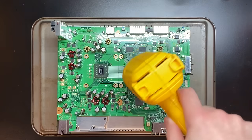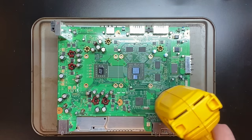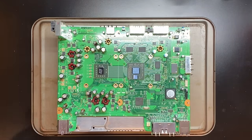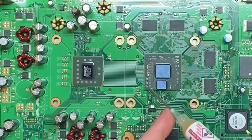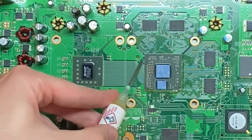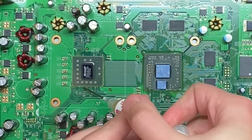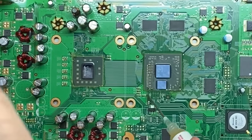Last step before we apply flux — spend about 15 to 20 seconds focusing on the CPU, GPU, and the memory chips. Then set the heat gun down and apply flux all around the GPU and around the CPU for good measure. Based on everything I've read, the cold solder joints that fracture and cause the red ring of death are usually on the bottom section of the GPU closest to the HANA chip. So you'll see me come back and apply even more flux to the bottom section of the GPU for that reason.